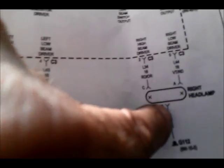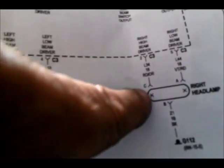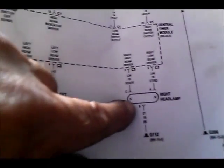You don't want to drop voltage across the ground. In other words, if I've got 12 volts going into this, by the time I get to the ground point it should be zero volts. If I still have voltage at this ground point — which I've already cleaned — that may be causing a problem. You need to have a good ground connection.